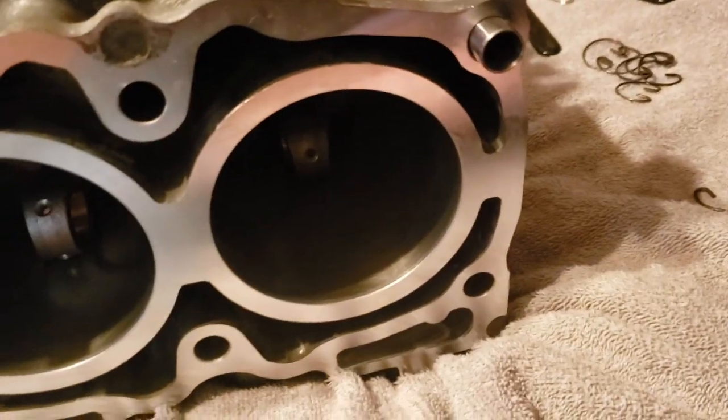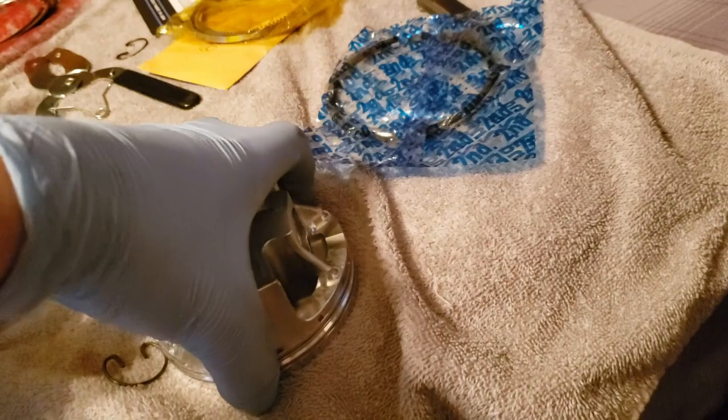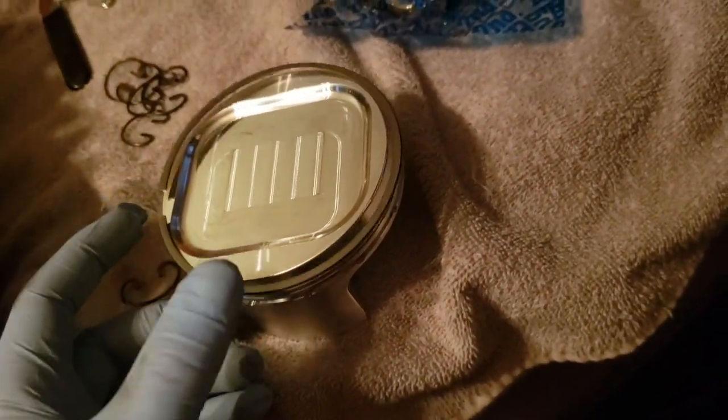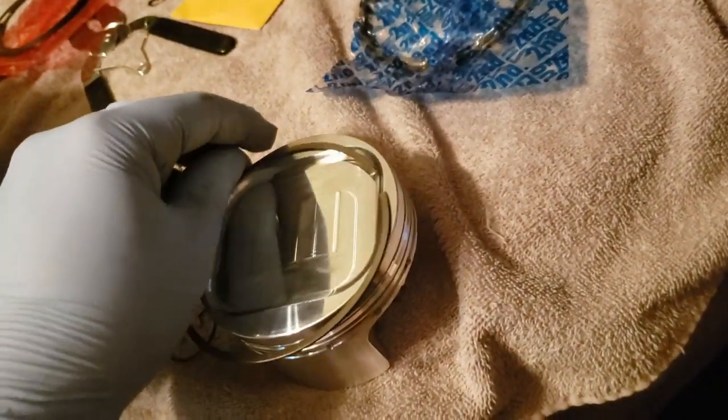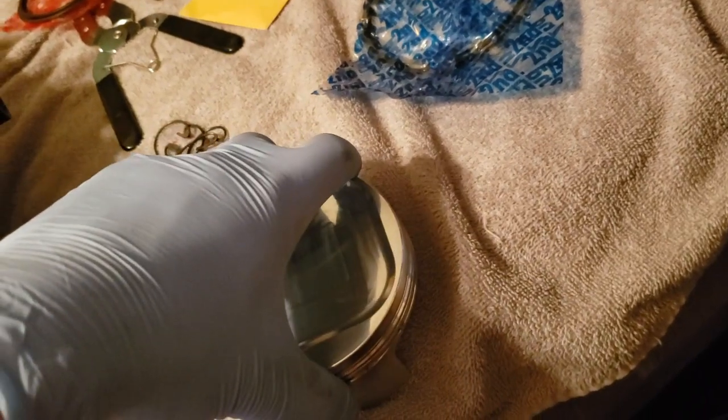I took very very little off — maybe three passes with 100-grit and that's about it. Now we will start to put our rings on our pistons. We'll start with the oil control ring, come in from the bottom, gently put on the oil control ring, then do the mid ring next, and lastly the top ring. We are going to offset all of our rings per piston — the top ring gap could be over here, the second ring gap over here, and the oil control ring gap over here. Even though the rings will move once the engine starts, for the initial startup we'll offset all the piston rings.